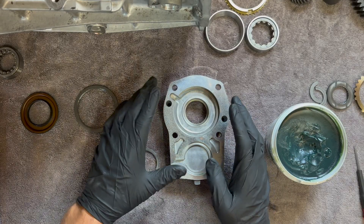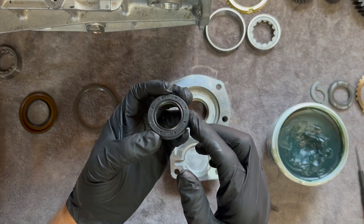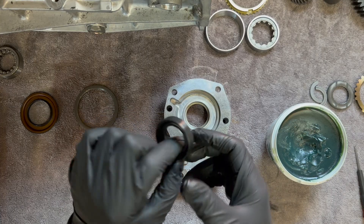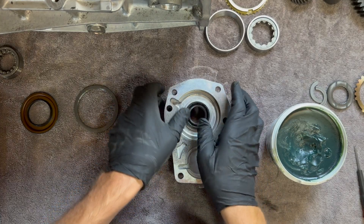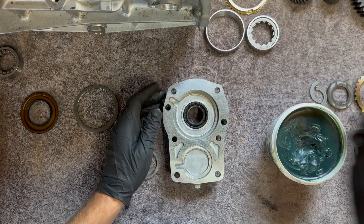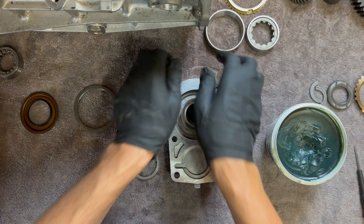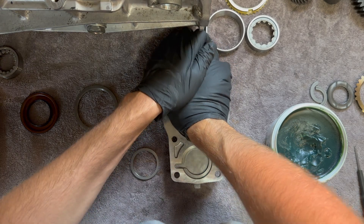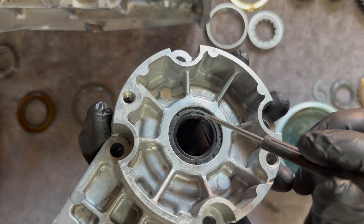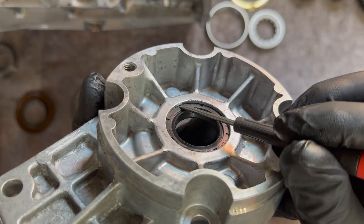Let's start off by pre-assembling some parts. I have this main gear drive bearing retainer here as well as the input shaft seal. I'm going to take a little bit of tack grease and put it around the outside. Now that we have it coated, you can essentially just push this in by hand. If it gets too difficult, you can use an old bearing race and push on the outside edge. I have one here that fits exactly perfect. What we are trying to achieve is no space between the seal and the gear bearing retainer — there should be no gap in here.